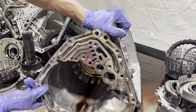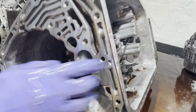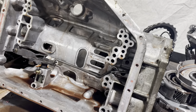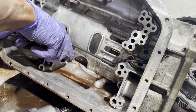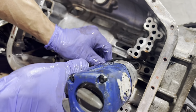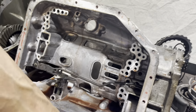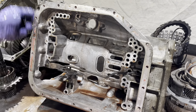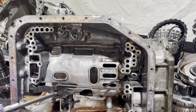Now we have the support down in here — take note that there's a bearing here. We have three torx screws that hold this in. One of them you usually have to move the parking rod a little bit to get to. And you're going to need a long torx — there's no other way to do it, because you've got to get down this tube and the socket's just going to be too fat.